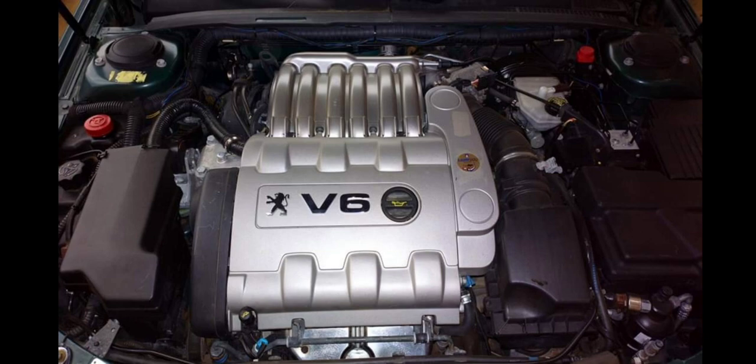When I want to do it, I cover some places. Of course, first you have to understand the engine. There are some porous places that you need to cover, which may differ from another engine. You need to check the location of your alternator, your ECUs, and your motorized throttle body. There are some sensitive electrical components where you need to check their locations, how they are mounted, and which parts to cover. Now, for this engine, there are places you could cover. Then there are places that you don't spray water on at all.